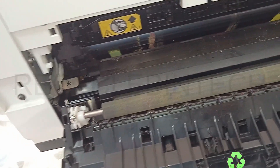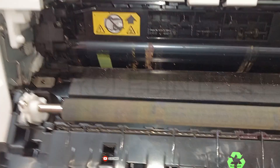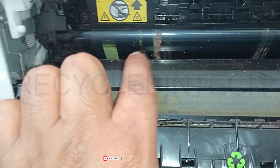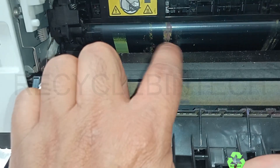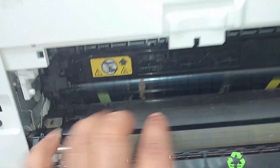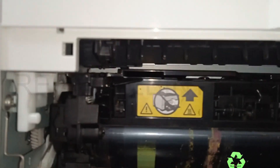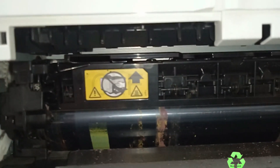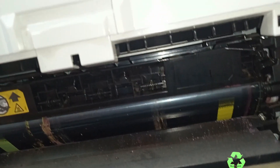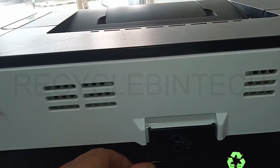To confirm there is no bit of paper still stuck inside, switch on your mobile torch or use a small torch. You can see on the film that the previous print got stuck there — that's why the image is on the film. If you print two or three times it will be okay. Check towards the top side for anything stuck. At present there is nothing stuck on the top side. After confirming, we can close this door.